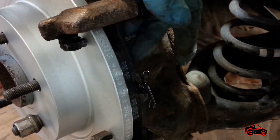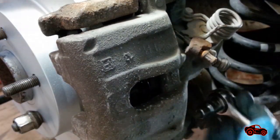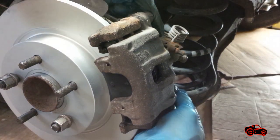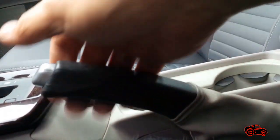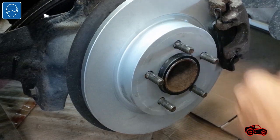With the caliper ready I installed the brake pads in place as shown. Then with the proper spacing the caliper was positioned without any problem. The two guide pins were inserted and secured on the caliper bracket — the torque for the pins was set to 22 foot-pounds. The two end caps were reinstalled to protect the guide pins from dirt and humidity. I pumped the brake pedal to compress and adjust the brake pads on the rotor, and I also checked that the handbrake was working fine. The job was okay and I removed the temporary lug nuts.